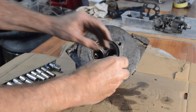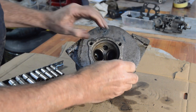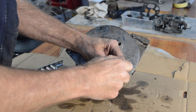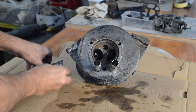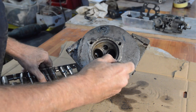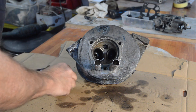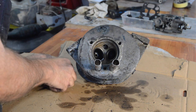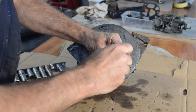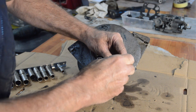Just get a deep socket that you can actually get in, if you can get one in. This is quite badly crushed. And then just massage it gently round. Go up a size. Applying the pressure where possible to the area of damage, because you don't want it going too badly out of shape.